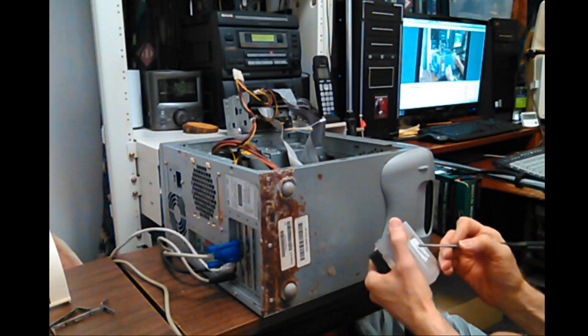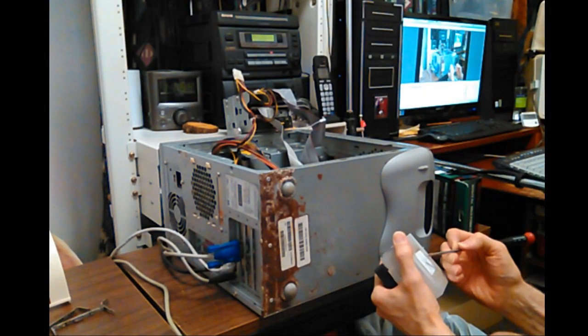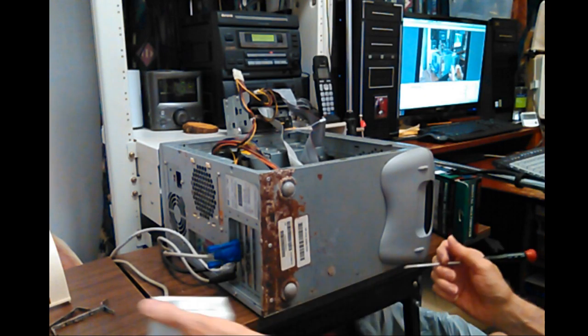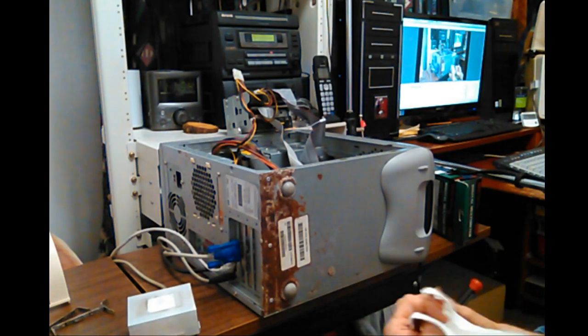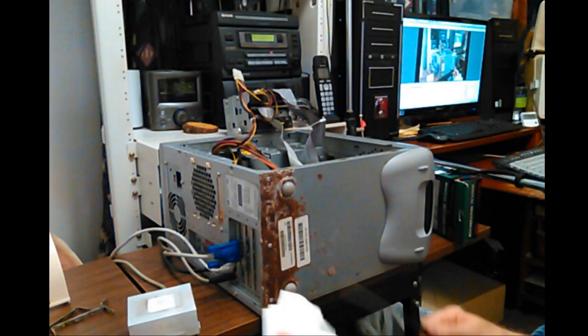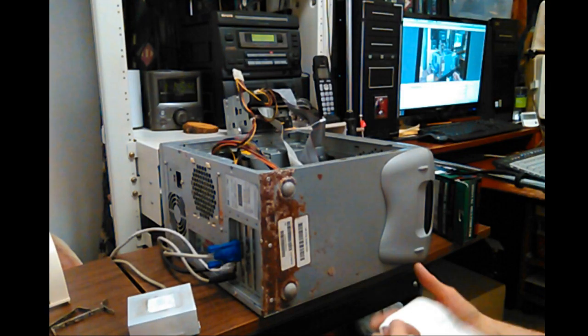I didn't think I was going to get that first memory DIMM out because it wouldn't open up all the way; the video card is in the way. It's an AGP card and it's really long and sticking out in front of it. It's only one slot too. It couldn't go anywhere else. Of course, it just depends on the brand as to exactly how they're made. But it may be a bad card. This one could have been in a lightning strike or something, you know.